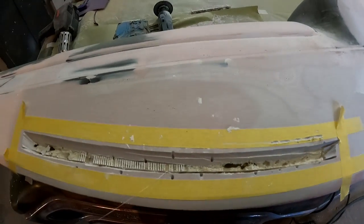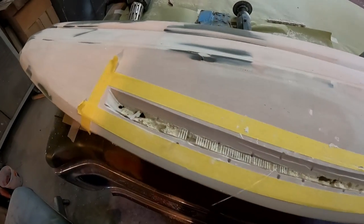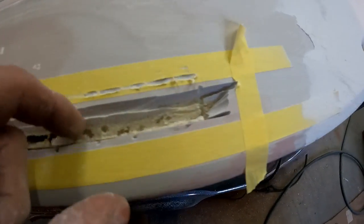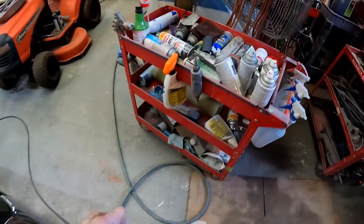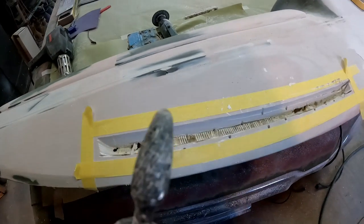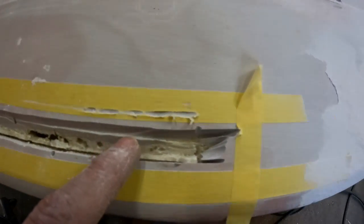It's hard to believe that started off as just foam, but it sure did. Now that we've got our channel started, what we'll do is come in and start cleaning this up a little bit, making it a little bigger. The way I do it — I have a reamer bit on another die grinder, and I'll get in here and ream this out just a little bit, work it a little bit closer to the tape, and then switch over to another tool.